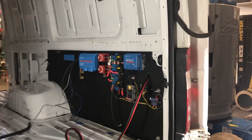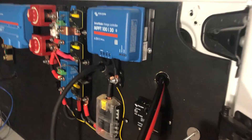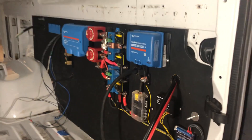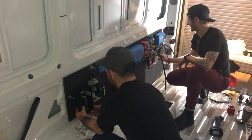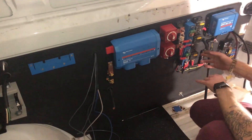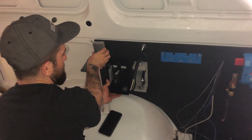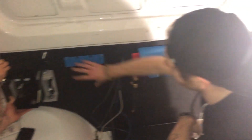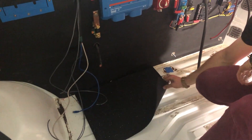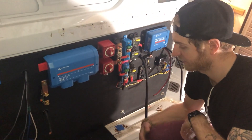Would you look at that — they installed the board. That looks sharp. I have to put some bolts on here, but this is solid. This is a work of art. So let's also bring a positive and negative feed for our DC outlet — we're going to bring it up and over and give him that outlet right here next to your AC. The inverter will sit here. This is a little mat we have for our batteries — it's a non-slip, almost like a gym floor mat, high-impact rubber. That's going to go down just to hold the batteries.